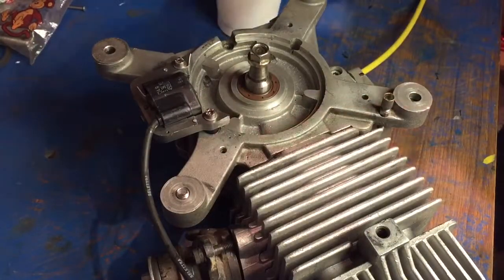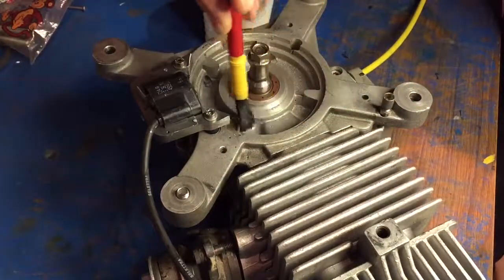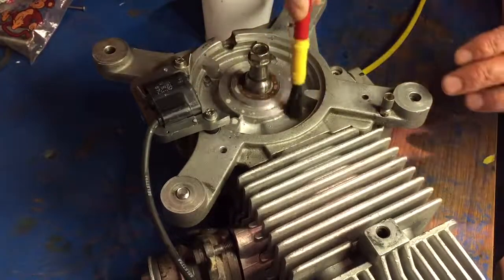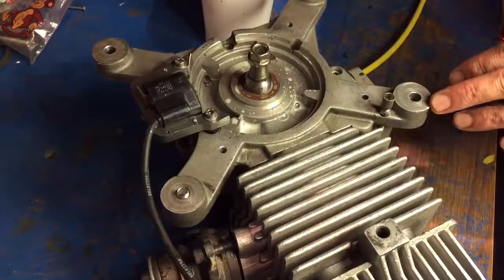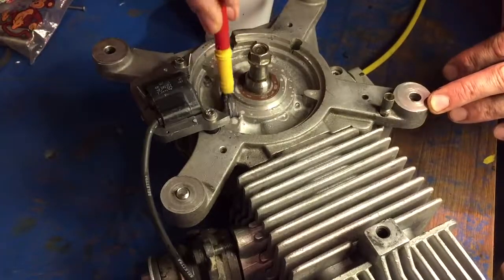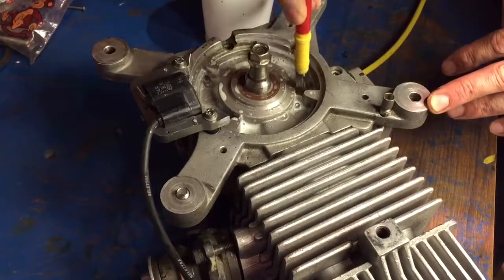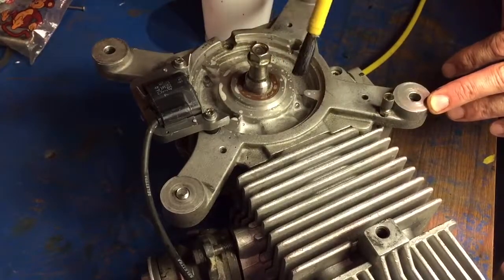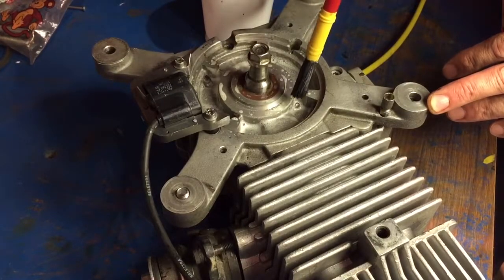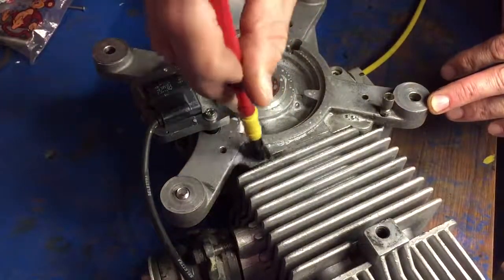I've connected up the pressure to the crankcase and now I proceed to paint everywhere on the engine — on the seals, on the casing. Casings that are cast are very notorious for having air leaks. You want to be looking at bubbles like this one here that are created and keep an eye on them to see if they get bigger. You have to paint the entire casing.